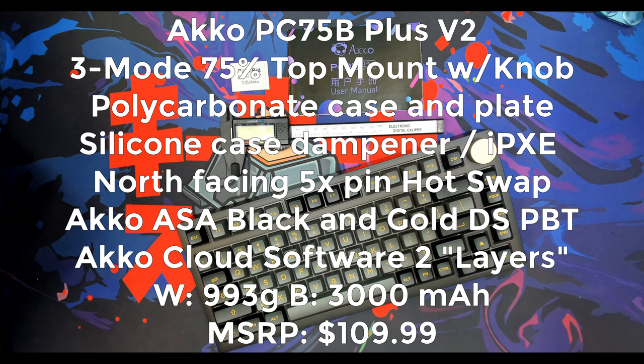This keyboard does use Akko Cloud software. It is available with either Akko CS Crystal clear switches or their white wine switch. This keyboard's MSRP is $109.99 from Akko Gear. It comes in weighing 993 grams. The chin of this keyboard sits at 20 millimeters from the typing surface, while the back sits at 33 millimeters, providing a default typing angle of 7 degrees.